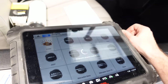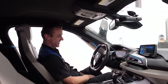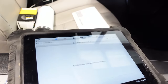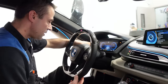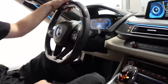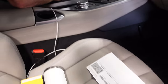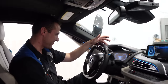The one thing I don't like about these is getting in and out - it is a process. Me and you are skinny too. I can't imagine if you have to move the seat every time. Listen to all the bings and bongs - bing bong city in here. So apparently I messed up Johnny - he was resetting the service interval. You do that by just holding the button. Brake fluid flush - push and hold, then reset. You can do it with a scanner too, but people think they need a fancy scanner. You don't - they left you with a simple button.